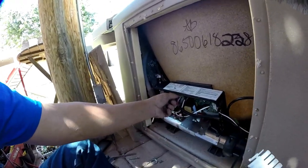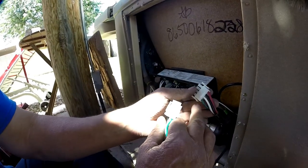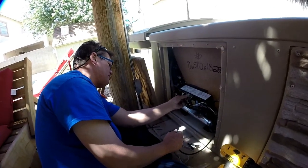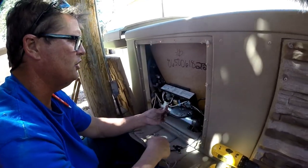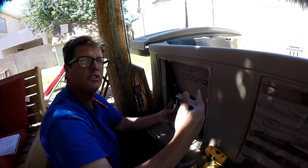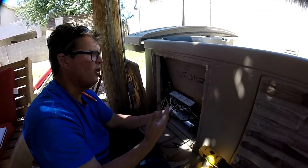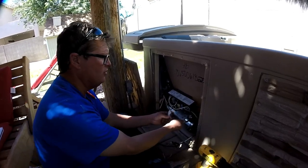This one has three wires. The pump has four wires because you've got high speed, low speed, a common, and a ground. If you're not sure which wire is which, you may have to pull off another panel and follow the wire around. I personally don't mark them because I've done so many, but as a homeowner or a newcomer, just mark everything — you can write on them with a Sharpie.